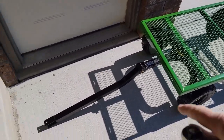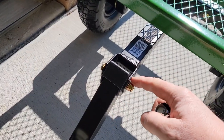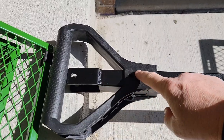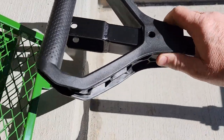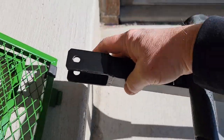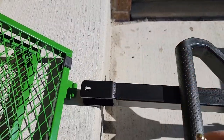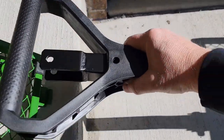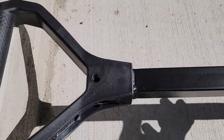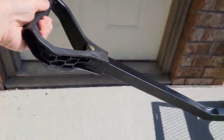Set it on all four wheels and put this handle on like this — this is half inch. Tighten it down, but don't tighten it so tight that you can't move the handle. Slide this handle on. When you want to hook it up to a wagon, slide this down and hook it up to your lawnmower using the pin and clevis that come with it. If you want to use the handle instead, slide it up, line up the holes, and put the pin and clevis through there. Now it's got a nice handle. Everything should move freely but not be super loose.